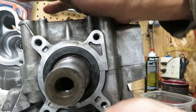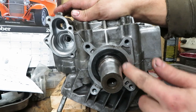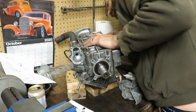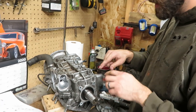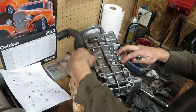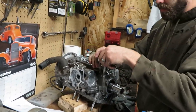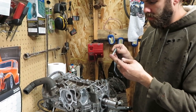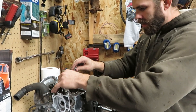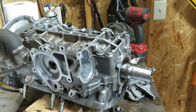There's a bit of a gap but it'll pull together. The spacer sits nice and flush. It spins freely. Now we're going to do the case bolts — there are ten of them: four on the PTO side, four in the center, and two on the main side. Drop them all in dry. Shout out to my father-in-law who wire-wheeled all these so they're nice and clean. Hand-start them all first.